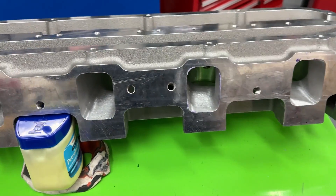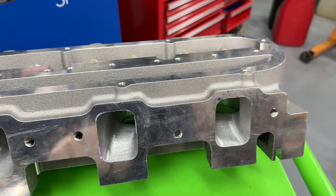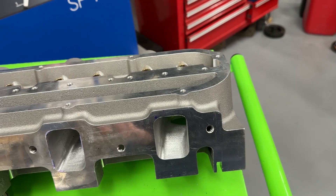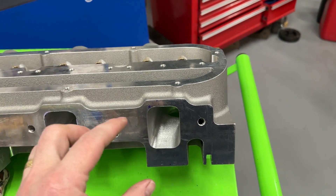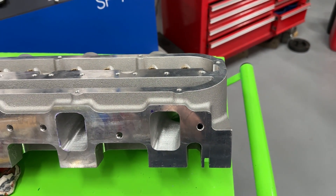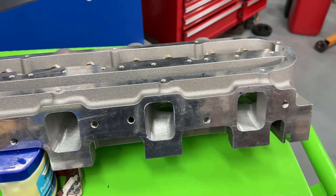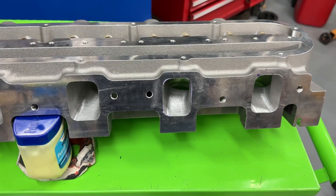Here's the intake port view — it's a really nice intake port, as you can tell. They are raised up, so the factory one is actually much lower. This is more of a uniform port, so your height and width are closer to being equal than some other stuff. Usually other engine families have a really tall and narrow port because they're trying to work around a push rod. These ones actually have more room, which is fantastic. It has a pretty good amount of area through here, which is nice because you need it — these 500 Cadillacs are actually much bigger too.